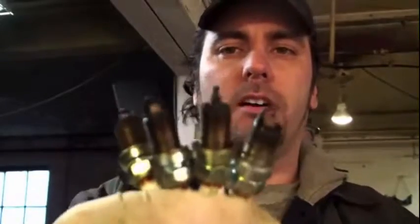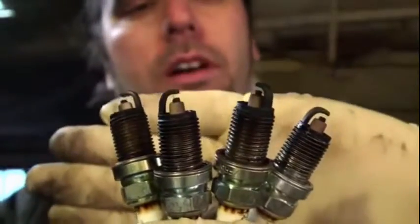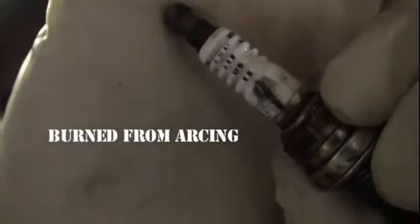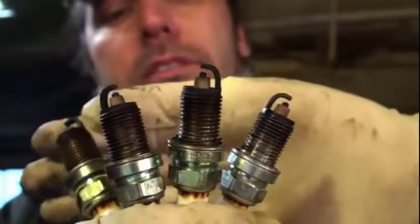If you feel you need a compression test — either you've got an engine miss or you don't have the power you expected — spark plugs are a good indicator because they're a window into the combustion chamber. What you're looking for is pretty much what you see here; these all look similar. Other scenarios include plugs gummed up with stuff, which usually means the engine is burning oil. Sometimes you see damage to the spark plug, like a broken or missing electrode — it may still produce a spark but not as well as it should.